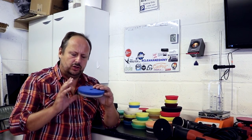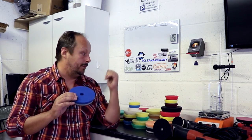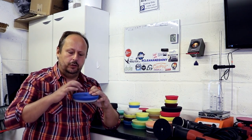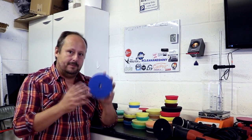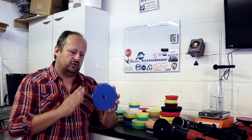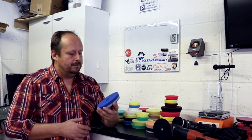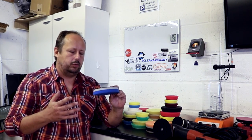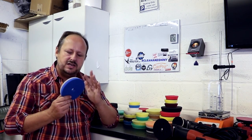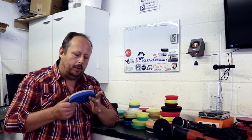There are some disadvantages to cone pads too. You get lifting around the outer edge, and these will try to stay flatter than a straight wall pad on a dual action machine — but as a result, they can be a little bit easier to stall. That lifting can also make it a little harder to edge with them and know exactly where your polishing boundary is. But you get a little bit of that with any pad on any dual action polisher.